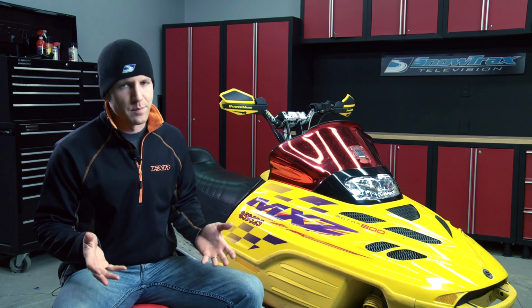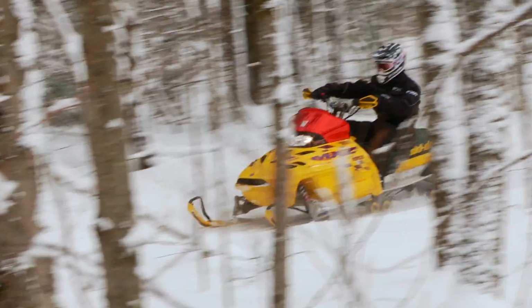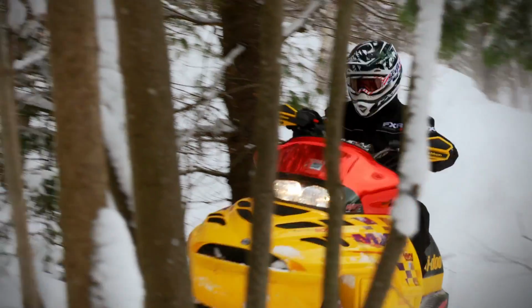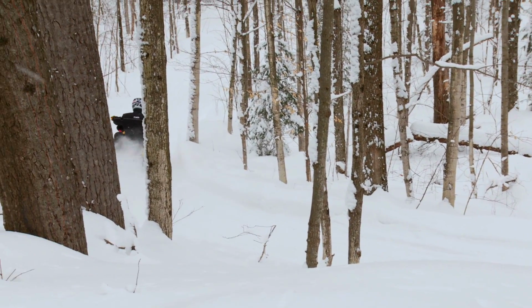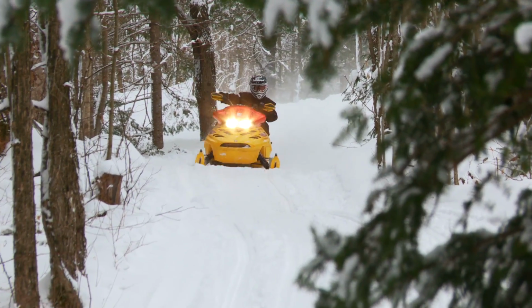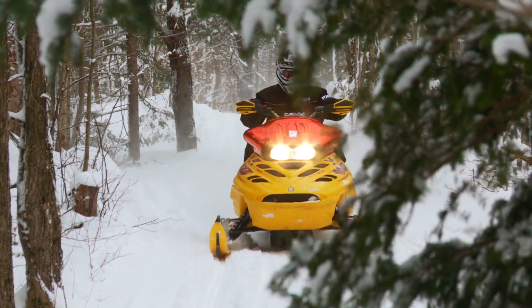Performance gains are always what people install an exhaust canister for, and our 600 carb Rotax will no doubt enjoy a much freer flowing exhaust with way fewer restrictions. Actual numbers are hard to pinpoint as each motor is different and would need to be dynoed to track the exact horsepower advantage. I found the most noticeable improvement was through the mid-range where the two-stroke motor really feels, well, pipey, and the power from this 600 felt far more crisp and responsive.